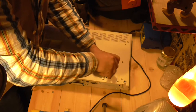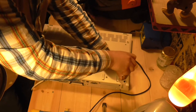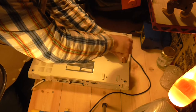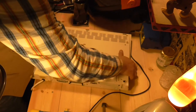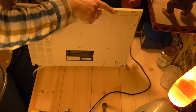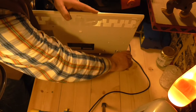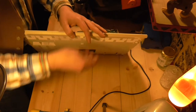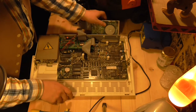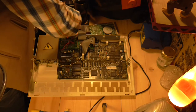I have removed the floppy drive once before to have a look underneath — that's what's underneath — and put it back in again. That should be the last one. Let's just leave it lying on the desk. Come on screws, out you come — one, two, three, four, which I'll put up here on the shelf. Right, we have the floppy drive there. I'm going to have to remove this board as well in order to be able to lift it out past there.